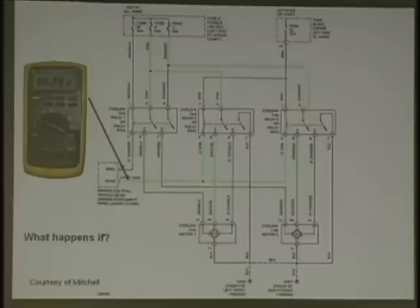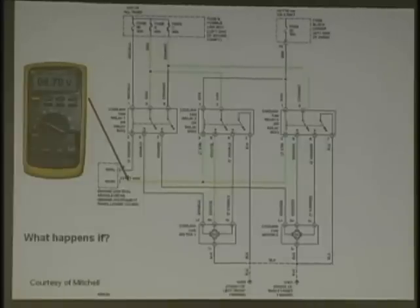If you had both. We took both of them. Right, we're just looking at one right now. Everything else is normal. Right. But you're right, if you had both of them. We're assuming right now everything else is good. All we've got is a problem here, all right? And so we're actually saying that at this point, those fans would not be working. So write that voltage down that you have there and say fans would most likely not be working.